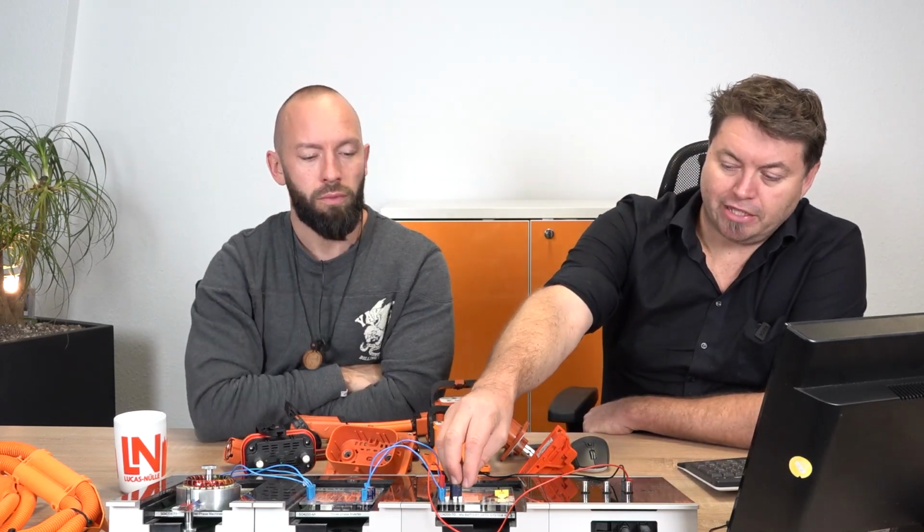Maybe in that case, just one word: we saw now the active discharge, but there's also the possibility, especially in older cars or when you have a fault in the system, of the passive discharge, which just says basically how long it takes to discharge the capacitor. Exactly. Not the battery, the capacitor. That's the capacitors inside the inverter, very large capacitors that are used to buffer the system during acceleration and deceleration, but they of course hold on to a lot of charge.